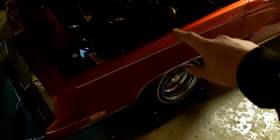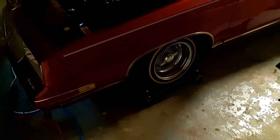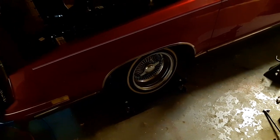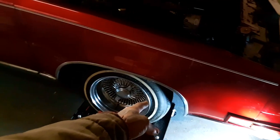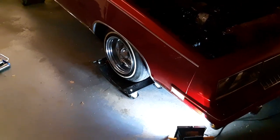We finished taking out the front hydraulic cylinders on both sides — now the front sits down a little bit lower. Taking off the sway bar and those bump stops, there's still about an inch of space, which gives us an idea of what kind of coils to get when we order the kit. Mounting up the 84s we ran into an issue with rubbing on the tie rod, so we're unable to use them. You guys got to see what it looked like with the swingers — stay tuned for more videos on this. Hit that notification bell and peace.